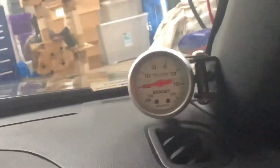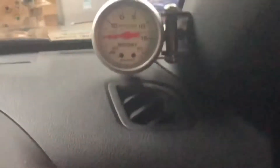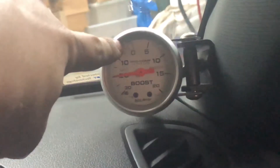As you can tell right there it's just hit a negative because at idle all it's doing is taking vacuum from the turbo, but if you can see — I'll put it in sport sharp here — when I hit the throttle it'll go to zero, which basically means that it's zeroing out the boost and basically building boost at RPM.